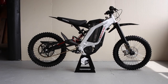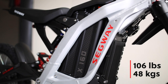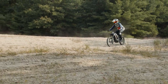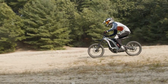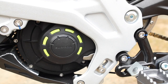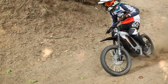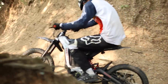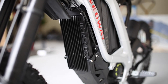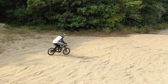Looking at the design, the X160 has a forged aluminum frame which keeps this dirt bike lightweight at 106 pounds. The battery weighs 18 pounds. For power, the Segway has 300 watts of nominal power with a peak power of 3,000 watts. The motor is located on the bottom of the frame, below the battery and near the foot pegs. This allows great weight distribution and a lower center of gravity, especially compared to most other e-bikes that have the battery much higher up on the frame. The motor is direct drive with a chain and large 48-toothed sprocket, which helps create 23 foot-pounds of peak torque.